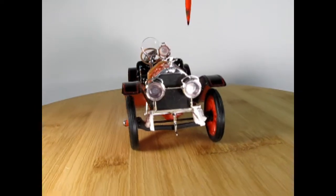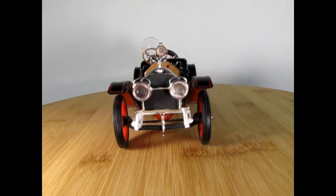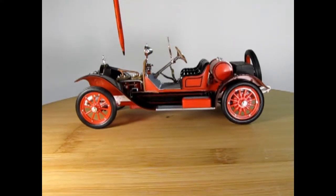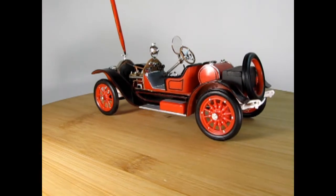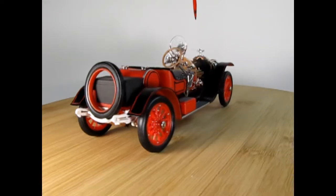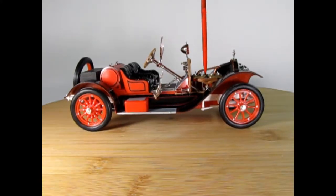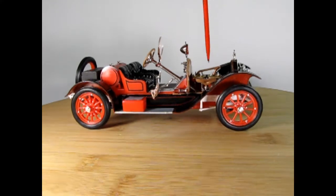The engine under here is the T-type. I'll remove the hood and spin around again. On this one you can actually see the valves on both sides — the inlet and the exhaust. This is the intake side and that's the exhaust side — I did look at this before but spinning it around got me confused. You can see all the gauges and instruments up here under the dash. This is the intake side, with the updraft carburetor feeding into that manifold on the cylinder heads.